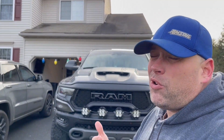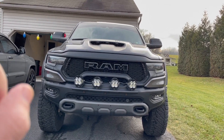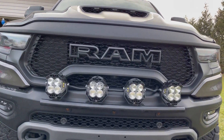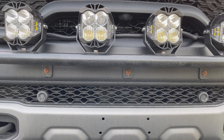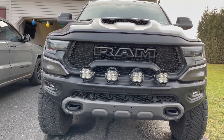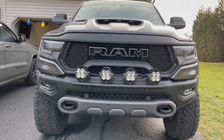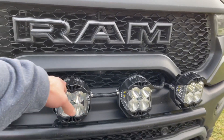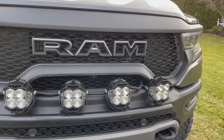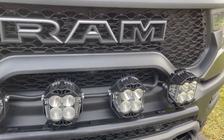It's been about a week or two since we installed the Brawler Fab light bar mount and I really like the appearance. I'm going to give you a completely honest review though — there are two things. With the mount itself, after two weeks here in the Northeast, the hardware is already rusting out. I'm probably going to reach out to Bill and see if we can swap it out for hardware that won't rust in two weeks. Also, with single lights mounted onto the post, there will be some vibration when moving pretty fast — you'll see the lights bouncing up and down rapidly.